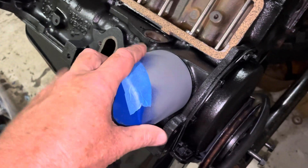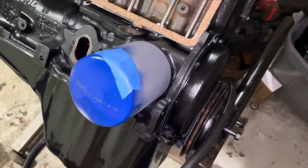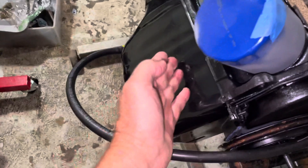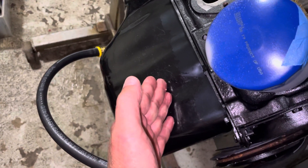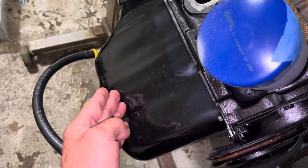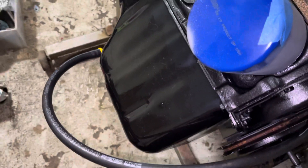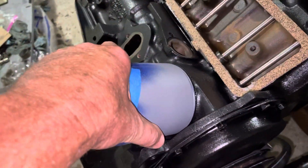The reason it takes so long to build up pressure is that you have to fill up the oil filter and fill up the passages in the engine before you build pressure. Also, the oil pump has to actually suck oil up to it. These engines have the oil pump sitting a little higher — somewhere around here — unlike a small block Chevrolet where the oil pump sits down in the oil and is automatically primed. So this pump may take a little longer to prime.